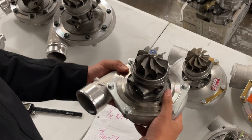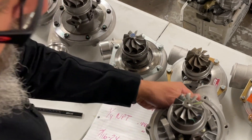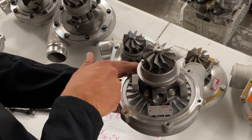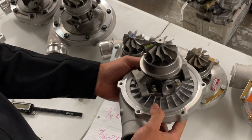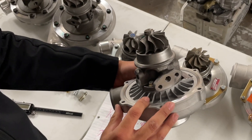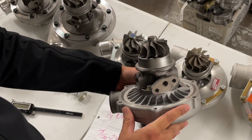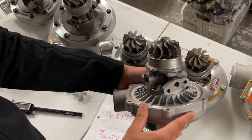The second one we're going to look at is the GTW. At first glance, this looks like your old T3/T4 style four-bolt that bolts the bearing housing to the back plate — so it looks like a legacy-style turbo. But it is newer in that it does have a ball bearing cage assembly and water ports. One of the ways to identify this is that the oil feed port is offset from the flange mounting bolts. This is the only style ball bearing turbo with that offset pattern, so if you see this, you definitely have a ball bearing cartridge assembly.